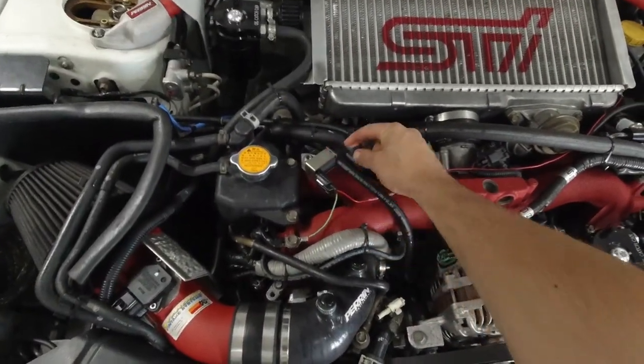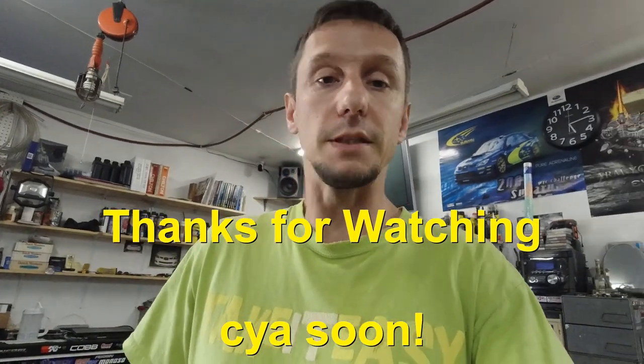So what I do when I want it to open, I need to be cruising. I need to have vacuum in the intake manifold. I just flip it on and off right away. Then it's going to remain open at all times, only because it's airtight. Meaning this inside here, it's airtight. But when I finally want to close it, I flip the switch on, I give it enough throttle to create boost, and I flip it off. So when I turn it on and give it gas, it creates positive pressure, the flap closes on the cutout, and I turn it off. And while I'm accelerating, it can last for half a second, and then it's off, and that's it, it's fixed.